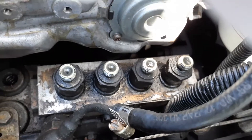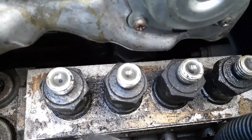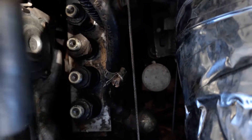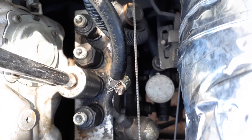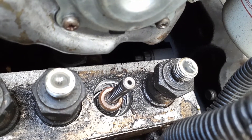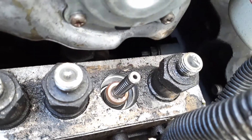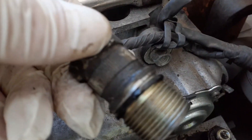Now we're going to do the fittings — the fittings will have to be undone with a 22mm. Once you pull off the fitting, what you'll find inside is a spring-loaded plunger with a washer at the top, a guide, and the copper sealing washer that you want to replace at the bottom. That's what you want to replace, along with the o-ring on the fitting itself.